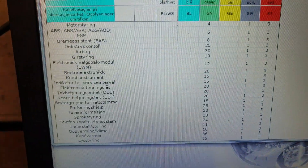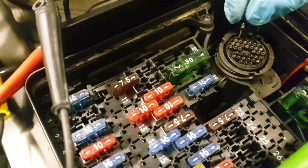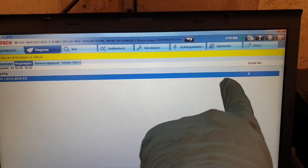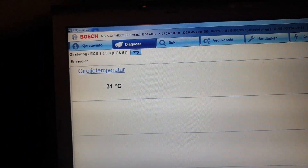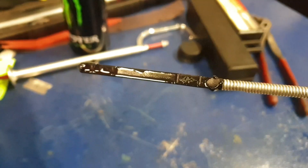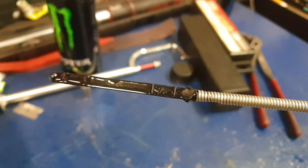The transmission is at 10 degrees — that is nothing. Let's connect it. Gearbox — look at that, no faults. Going to actual values: gear oil temp. Putting it in drive... 31 degrees. I can measure the first step, the 25-degree starting point. That is spot on — it's just above 25. You can see it was at 31 degrees Celsius. That's pretty nice. I'll leave it there for today.